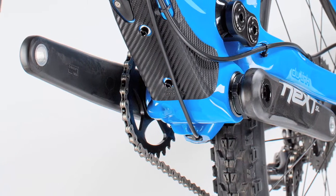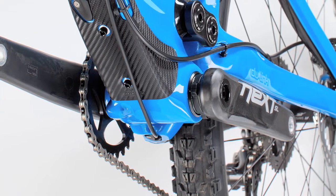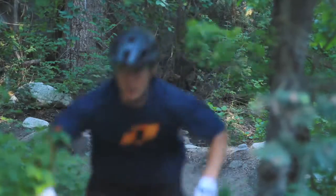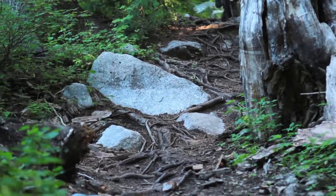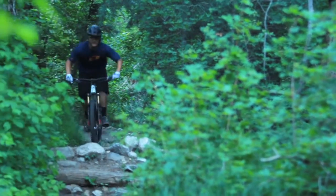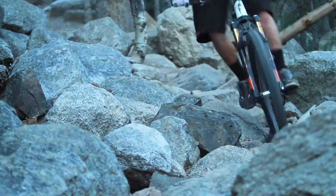All our mountain bikes also feature the Press Fit 92 bottom bracket design. We co-developed this design in conjunction with Shimano. The Press Fit 92 design allows us to maximize the space between the crank arms to be as wide as possible so we can employ wider pivots and tube cross sections as well as supporting the bearings as close to the outside of the crank arms as possible. This gives Pivot frames maximum stiffness in the most critical area and the best bearing longevity as well.